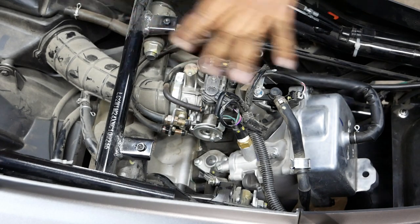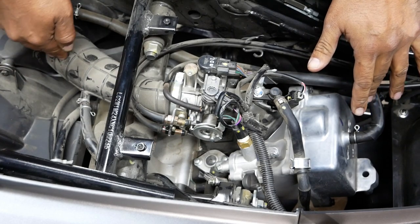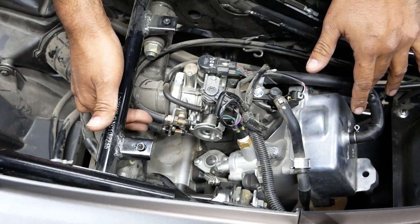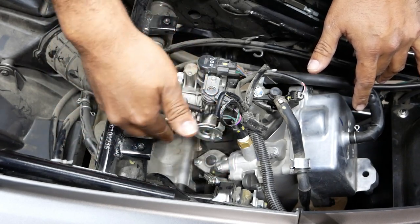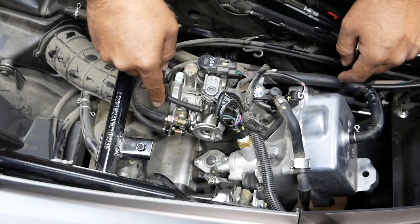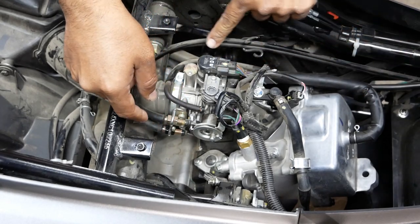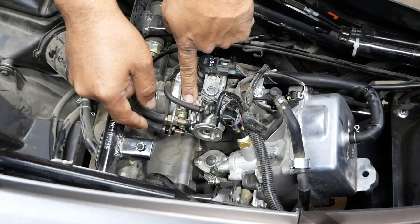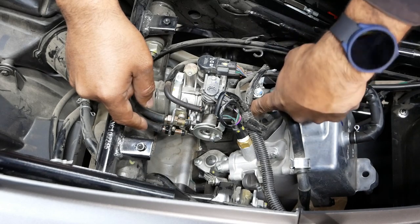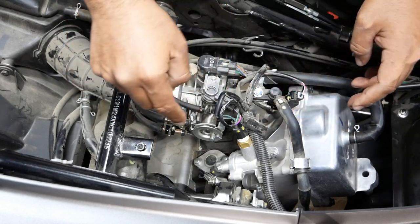So down here, we got our intake, air box, so that's where you're at there. If you come right over, you got your throttle cables, okay? Your accelerator, decelerator, which is what actually pulls the cable back and puts it in place. You got a breathing tube right here. You got your throttle position sensor, your fuel injector, your throttle body, your intake manifold. This is the actual intake manifold underneath it.